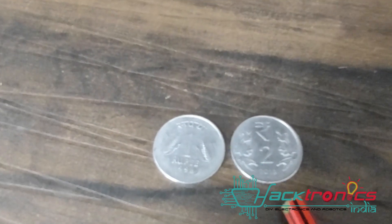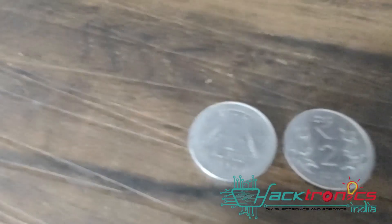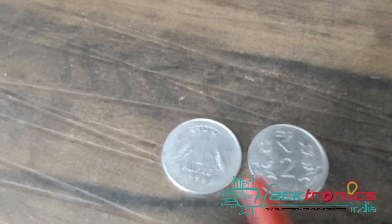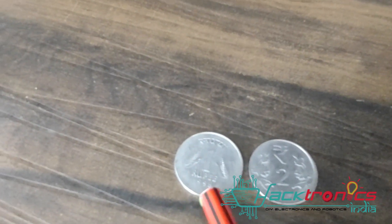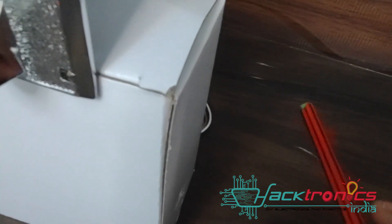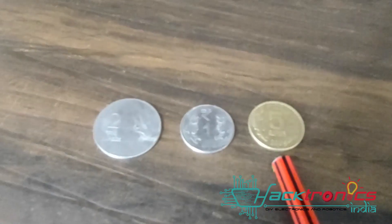One of the issues with this coin slot machine — we didn't really want it but I'm showing it for demo purposes — is that the 1 rupee coin and the 2 rupee coin are completely identical in size. It is impossible for this kind of machine to detect the difference between them. If you insert a 2 rupee coin it will detect it as 1 rupee only, which creates a lot of trouble. You need coins of different sizes — a large coin for 2 rupees, a small coin for 1 rupee, and 5 rupee coins are yet another size.